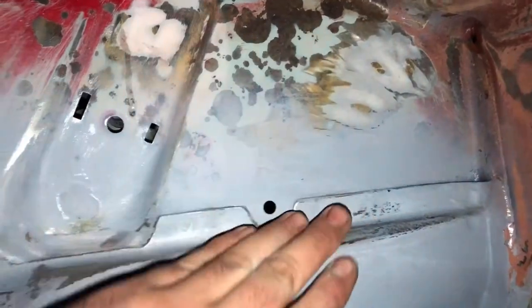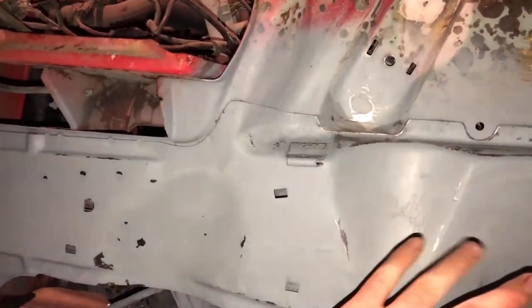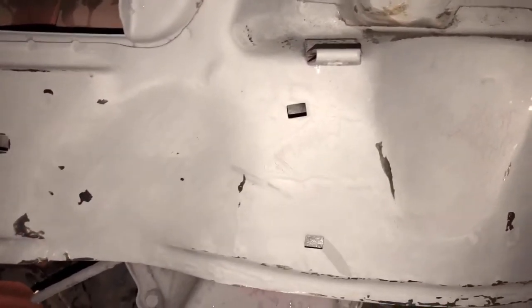It's been about four days since the last clip and that four days has been non-stop sanding, painting, filling, sanding again. Each time I've done that process it doesn't look any different but it's feeling that little bit better. Now it's at the stage where it's ready for a full coat of primer. I've filled the holes in up here, that one and that one, and I've sealed that seam — that is all nice and flush and all the seams are metal. With a coat of paint on it, it'll look like it should be there. I red oxided the whole thing and knocked it back, and as we can see the red oxide, even though it's dry to the touch, it's still not cured and it's not laid right on the paint. So before I primed it was nice and flush but now I've primed it on top of the red oxide it's all standing out, but I'm going to prime it anyway and then when I come to final finish the paint will be well cured.